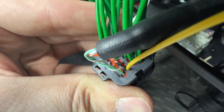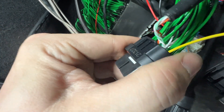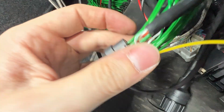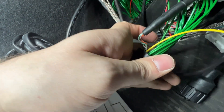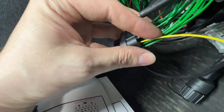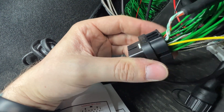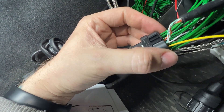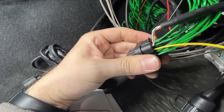You can see right there, next to the yellow wire, it says 19 — that is the pin we need. On these plugs, you have one side with a long rectangle and the other side with two small ones. To release the pins, all you do is press this guy down — it pops — and now you can pull any of your wires out. To keep them in place, just press that guy back in and press these guys down. Just like that, it's all flush, and you can pull on the wire and they won't come out. I absolutely love these plugs — pretty standard on most standalone ECUs like Motec, FuelTech, and Emtron. That pretty much wraps up the fuel pump, and I hope this helps.